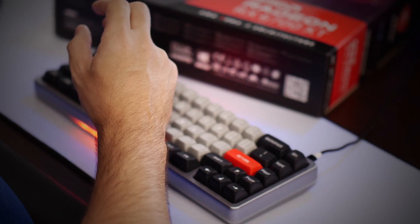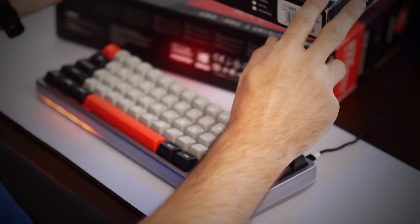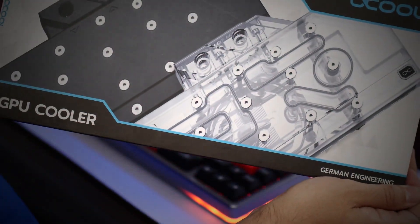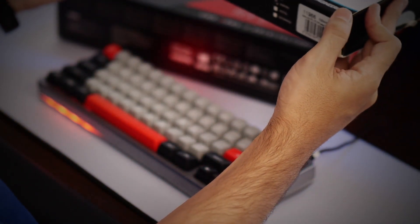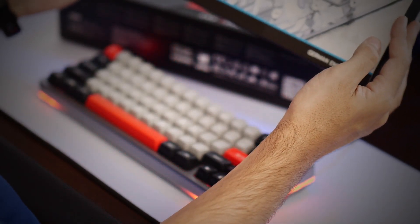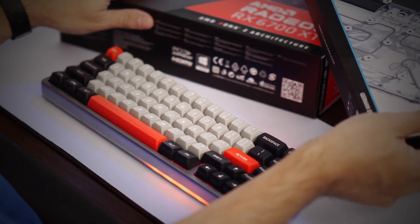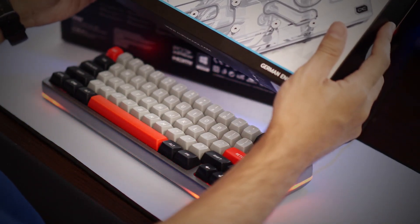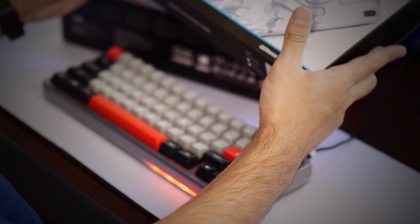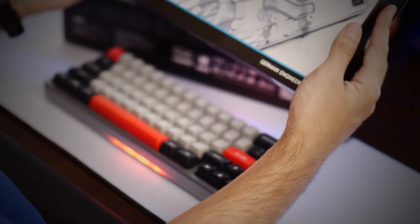So I dug deep and investigated a bunch. It's not a reference model, so I can't use any reference water blocks. But I did find there was another one — an AlphaCool block, which you can see here — that is built for its sister GPU, the RX 6700 Gaming Trio. Now, it's not for this graphics card, but I was intent on figuring out if it would work. And well, it did. The PCB is practically identical, which means it cools really well, it's a good fit, and it looks great.